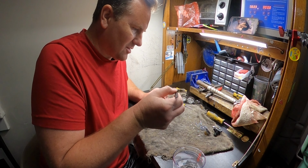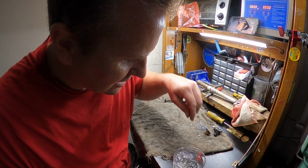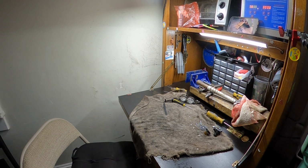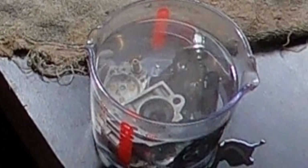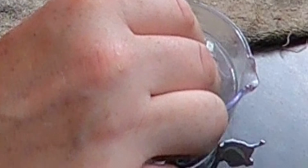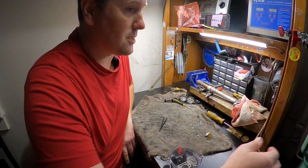The needle valve is good. The tip is not ruined. It came right out. So I think we're good with the hot water. I'm gonna drain this and put some more boiling water in again. Oh yeah. I can't even grab it, it's already melting. So I don't know if you could actually see that, but whatever that is, which I think is sugar, it's just going right through it. The hot water is doing perfectly exactly what we would want it to do. All right, guys, I am feeling much better about this.